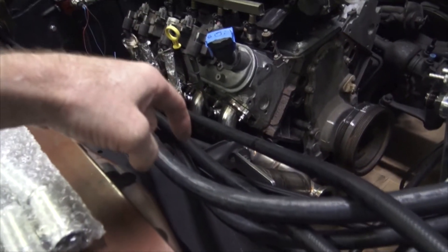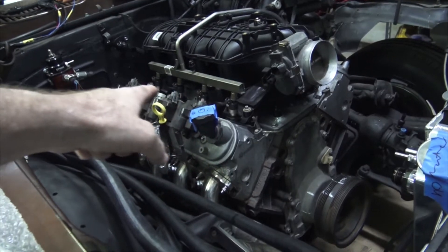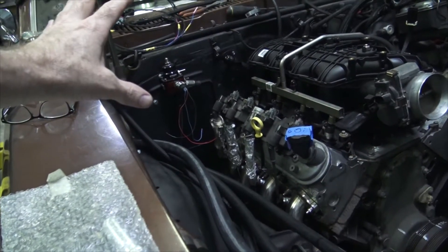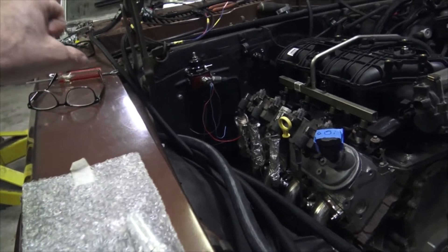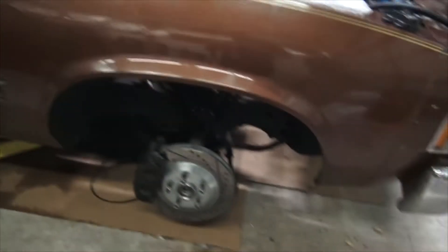The new VS Racing 7875 turbo will be sitting there, Trailblazer SS intake, and we have CNC ported heads with springs and valves from Modern Airflow Dynamics, or MAD. So that's about it there. We've got 120 injectors and a dual pump system set up where we run two — I think they're 280s or 320s. One just runs all the time, the other kicks on when we see like zero KPA, or maybe we'll set it up as part of throttle — haven't quite decided yet.